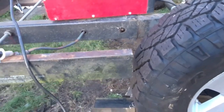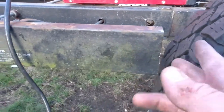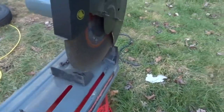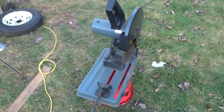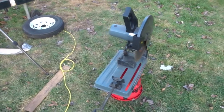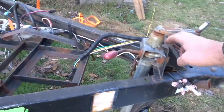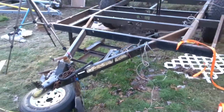I had to cut a little bit more of the frame than I had hoped. I thought it would be higher up on the tire, but that's not a problem — I'll probably end up cutting this later on at an angle. I'm going to do steel directly back because this section is flimsy, there's nothing holding it anymore. I did start cutting the axle with the saw, but it was taking forever to cut through so I had better luck with the grinder. Because I left a little bit of play between the axles, I cut about a quarter inch more than needed. There was enough room that if I was slightly off with my angle on the grinder, it wasn't really going to matter inside the DOM tubing. The jack is a little too low for it now — it's cranked all the way up and it's pitching forward pretty well.